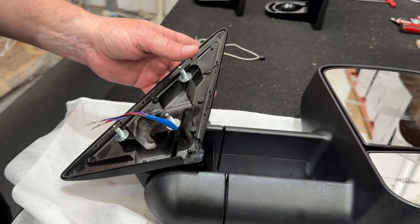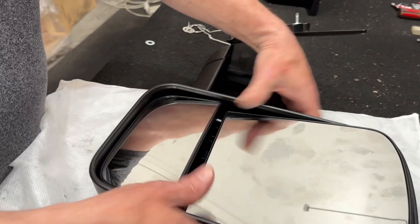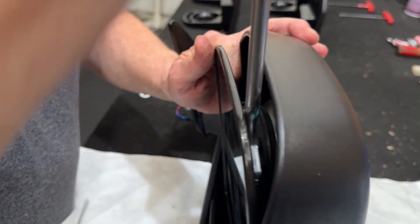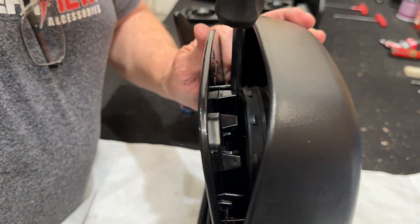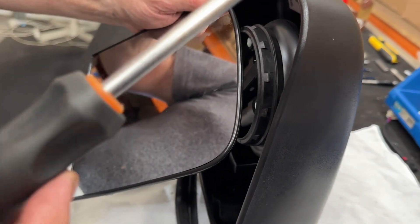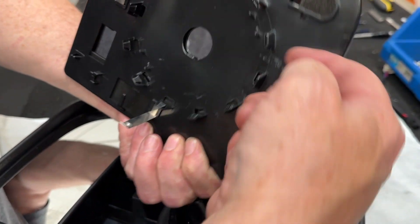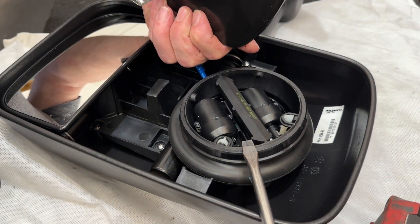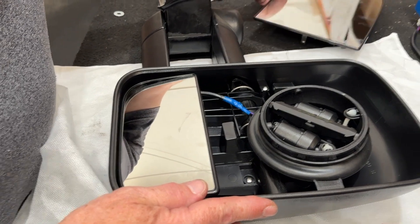I'll make this the easiest way possible. There are a couple of different ways of doing it, but this makes it a bit easier. First thing, take off the glass using a flat screwdriver. Some of these are easier to remove than others. If you've had your mirrors four or five years, you might find it's a little bit tricky. Don't force it. Turn your screwdriver to get a little bit of purchase between the clips, and turn it slightly to the side so that you're breaking the seal. Take the mirror off and set it aside.